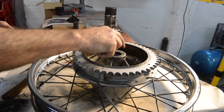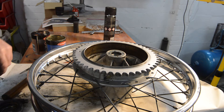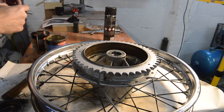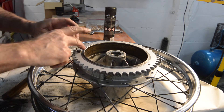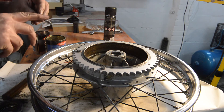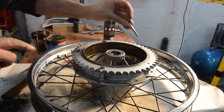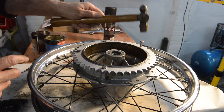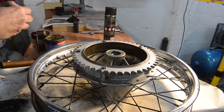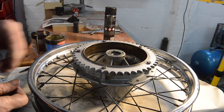Right, now we know the brake fits. I've had the retaining ring off as we saw with the front wheel, and I've cleaned and repacked the bearings - they're all in good condition as far as I can see. So next we're going to fit the sprocket, which is again unworn, so a bit of anti-seize on the shank of the bolts and securing nuts on the underside.